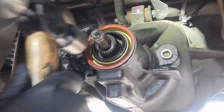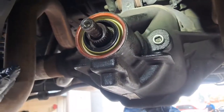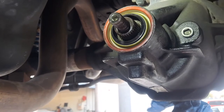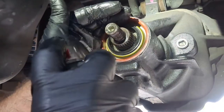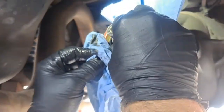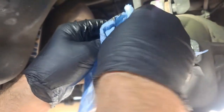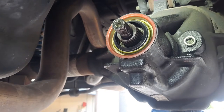So, what I was saying, when we pull this nut off, we're actually supposed to take the differential all apart, and we're supposed to replace that one-time use crush sleeve. However, that's a big job. This is a pretty small job. So we're not gonna make a small job into a big job, but that's why this job would actually pay a lot of hours. Now, also, what I've seen in the past is they may call for some sealant, actually, on the splines of this.